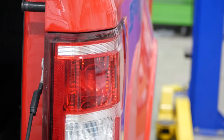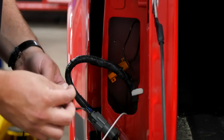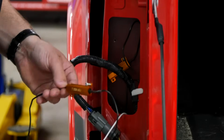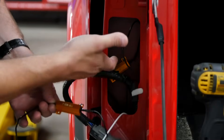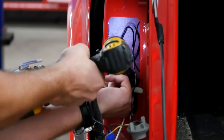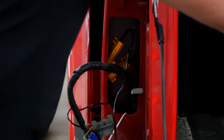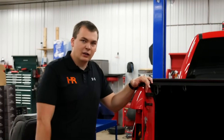I can actually feel it getting warm already, which brings me to my next point: these resistors get hot. They're not going to burn your truck down, but you need to be careful where you put them. Take your resistor and the supplied sheet metal screw — I usually put the screw all the way into the resistor first so if I drop it, it won't go too far. Take a drill; you can see in here already where I have one resistor mounted — that's perfect, it's not in the way, not touching any wiring. I'm going to insert this resistor and tighten it down. Now is a great time to tape up any wires you stripped back that you didn't connect to, like this yellow wire here when I was testing it.